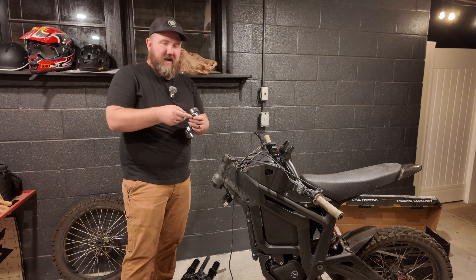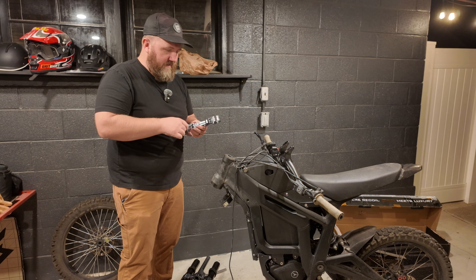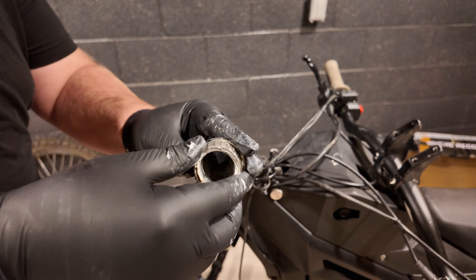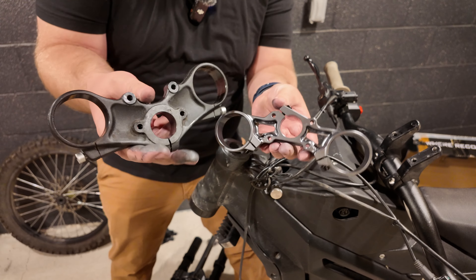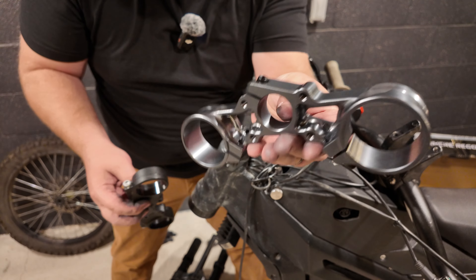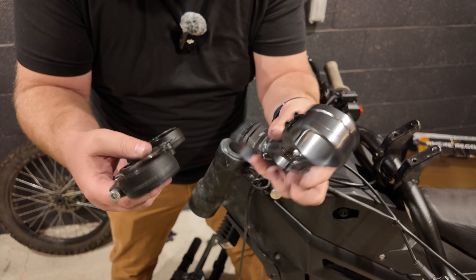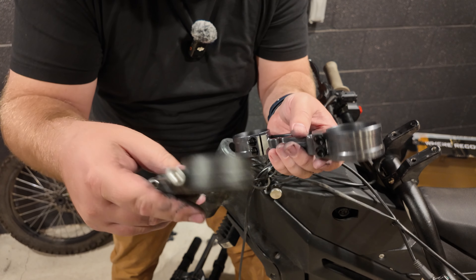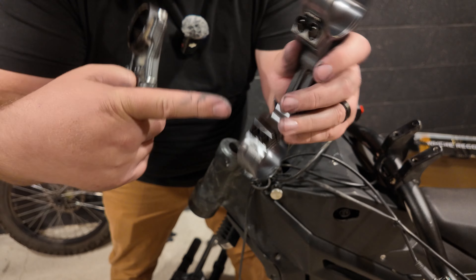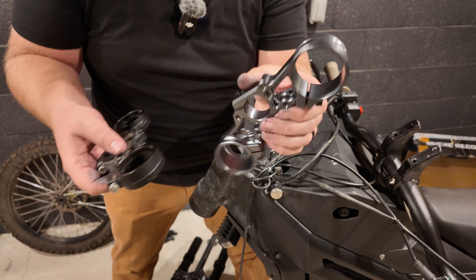The first thing I want to do is see how much of the tube I need to cut. You can get spacers so you don't need to cut the tube, but that's what I've done on the Fastace, so I'm going to do the same with these forks. I want to show the difference between the two crowns. The Fastace one is slightly heavier and looks a little beefier, with no cutouts, whereas the Reflosa has cutouts you can see right through. I like that the Reflosa has two screws to clamp the suspension, whereas the Fastace only has one. They also give the torque in newton meters, so you know exactly how much to torque it.